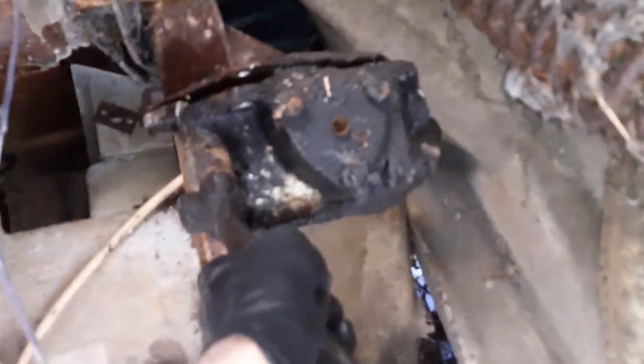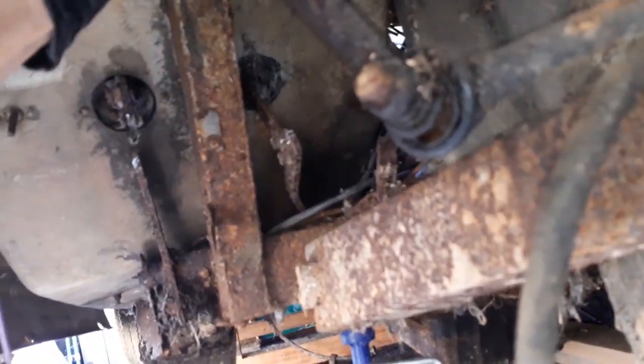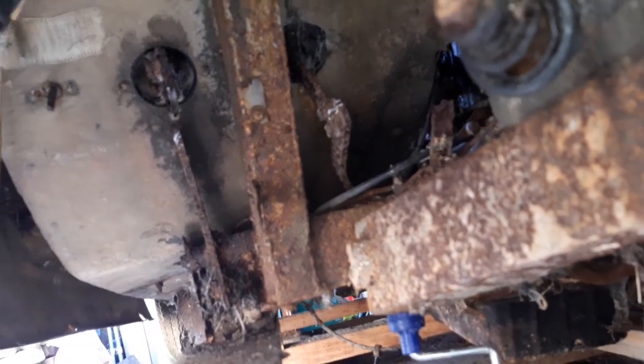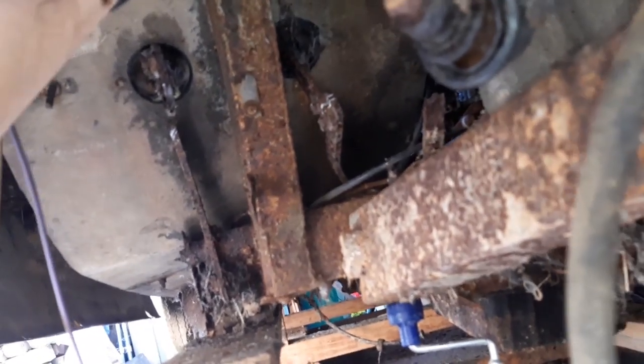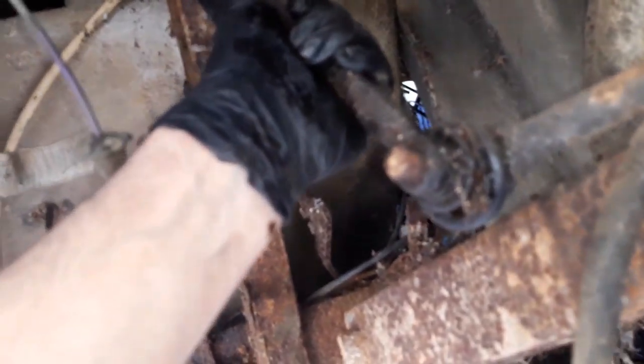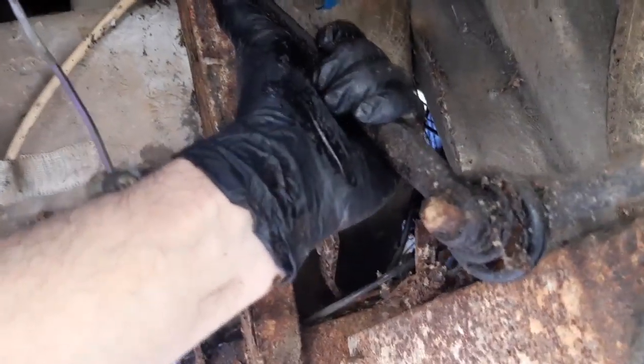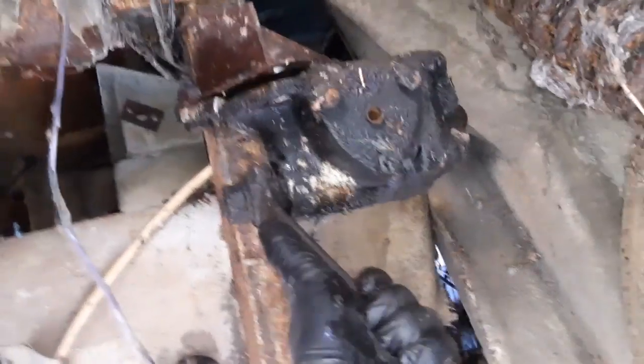I've managed to get that steering box, all the mud and crud on there, I've managed to get the steering box loose. So now what I'm going to do is split it here or here. Here looks like my best bet. Get this banged off. There's no chance of these coming undone. And then I should be able to just draw the steering wheel out. Steering column, actually. Cool.